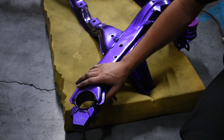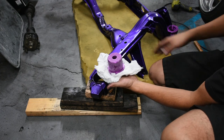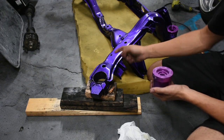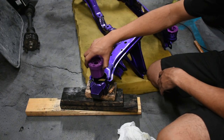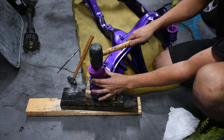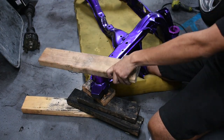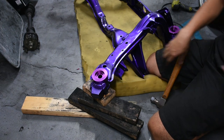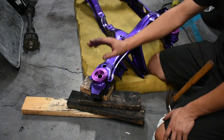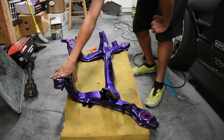So now I'm going to move on to actually pushing the bushing in. Here is the solid subframe bushing that's going in. As you can tell it has a whole bunch of frost on it, and that's because it's been in the freezer for the majority of the day. The reason for that is to get the bushing to slightly shrink so that way it's easier to press in. I'm going to make sure that the bottom of the subframe is facing up — these are going to get pressed in from the bottom. I have pieces of wood right under where the bushing is going to go so I can support the subframe when hammering it. I'm going to take my rubber mallet and hammer in the bushing. Just make sure it's seated all the way down to the bottom and that's it for the install. Here's a view from the top of the subframe so you can see that the bushings sit nice and flush.